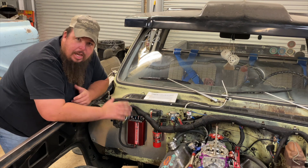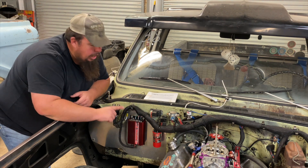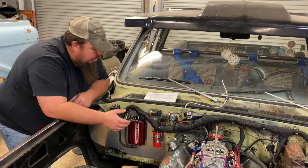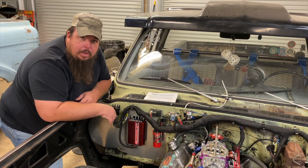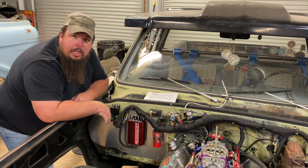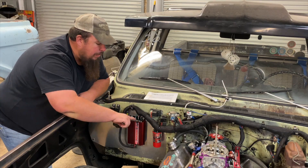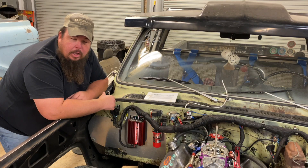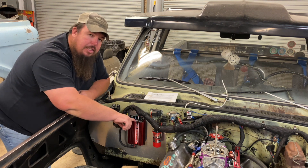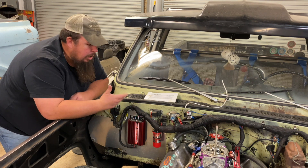One of the main reasons I really like this Digital 6 Plus box is it's made for racing and it's got a lot of really cool features in a compact box. You operate all the features through this row of dip switches. Starting off, you have your top end rev limiter — that's to keep the engine safe in case you lose traction or have a drivetrain failure, so you won't scatter the engine into pieces. Then you have a two-step, which is for getting on a trans-brake or line lock. It lets you pick whatever RPM you want to leave off the line on. Setting these up is as easy as just turning the dip switches and setting the dials to whatever RPM you want.